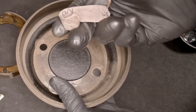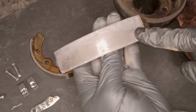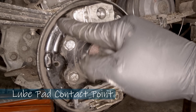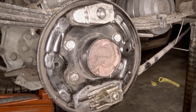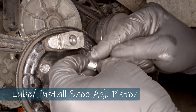I'm going to use some emery paper and lightly clean the inside of the drum, just removing any buildup. Here's the brake pad — see this shiny part? You can see we've created a little bit of crystallization on there. We've got plenty of material left on this pad, so I'm just going to take that same emery paper and scuff up the surface of the brake pad. This will help break it in once it's back together. Now we're going to grease all the points where those pads make contact — this helps with any brake noise. We'll also put some lube on the brake shoe adjustment.